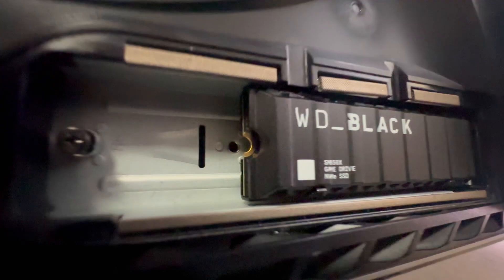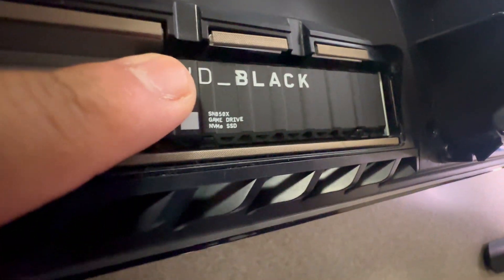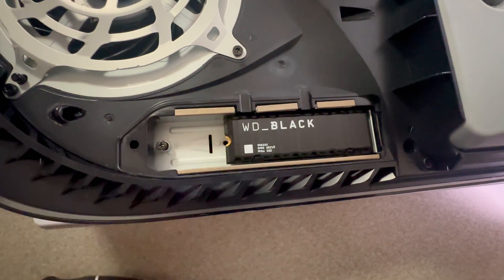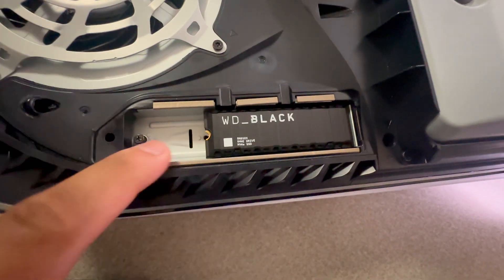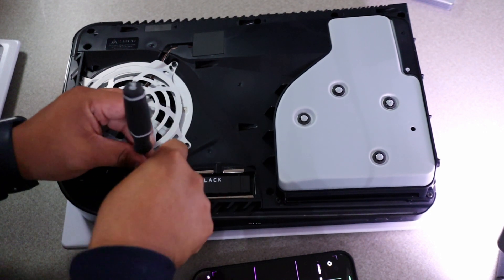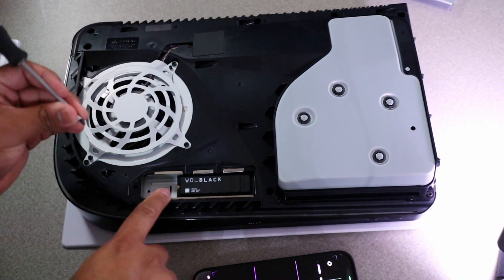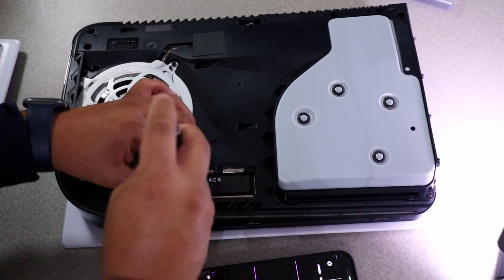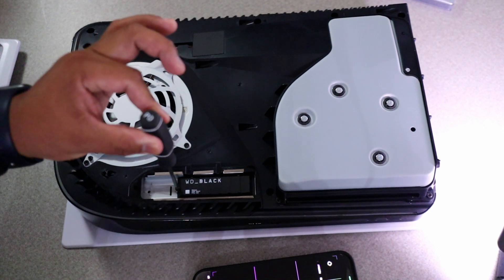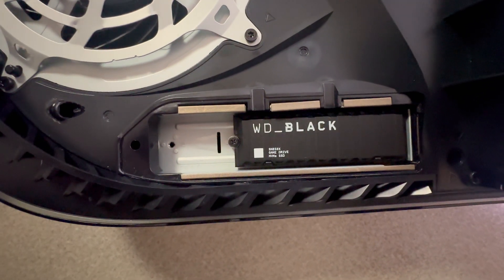It's in. You do have to get it at an angle — as you can see, the drive is at an angle right here. Once it's in there though, you can actually just sit it back down. Now this is another really important part. You see the screw right here — this is going to be used to tighten this right here. So let's take this screw out and put it in right there where the hole is. When working with these little screws, these are small screws on a very fragile device, so you don't want to over-tighten anything — just hand tighten. We're going to move it into here like so, and it should sit nicely. It should line up nicely because again, this drive is made for the PS5. Tighten to where you hand tighten. Don't over-tighten anything. And there you go — now our device is nice, tightened, and ready to go. Ready to rock and roll.